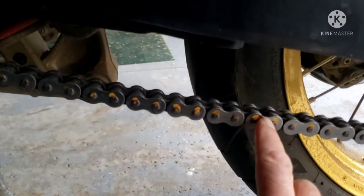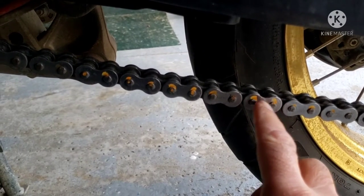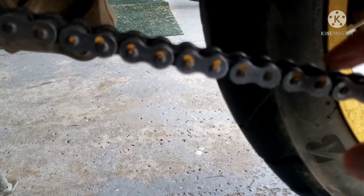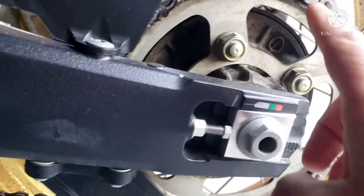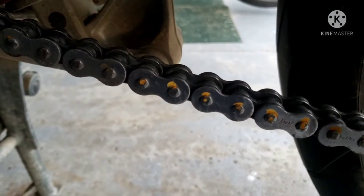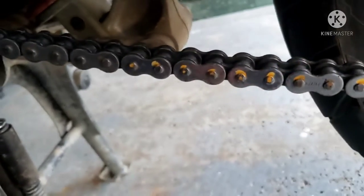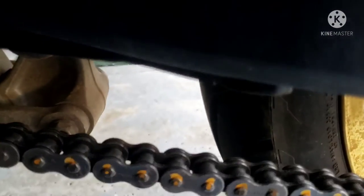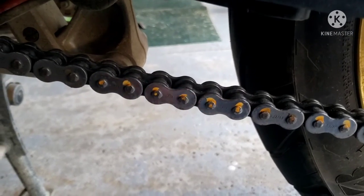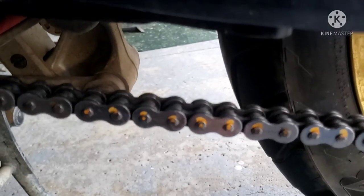The parts of a chain are the side plates — that's this figure-eight-looking thing — the pin which holds the two parts of the chain together, and then there's an inner side plate and a little roller on top. That roller is what's connecting to your sprocket. Inside that roller on an O-ring chain is grease from the factory. Grease is impregnated into the inside of the roller, and to keep that grease in between these plates there are little O-rings or X-rings.